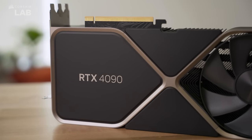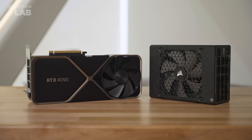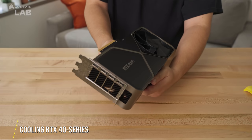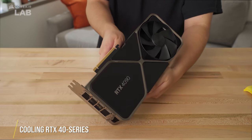That cable is available and it is a much cleaner solution — it provides more than enough power for a 4090 and the 4080s, delivering that 600 watts no problem. To summarize: 4080 needs 750 watts, 4090 needs 850 watts. These cards do still run hot — they put a giant heat sink on them — so there's obviously some heat to be taken care of.